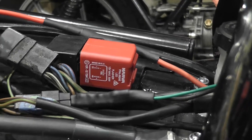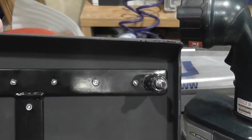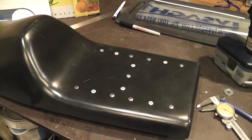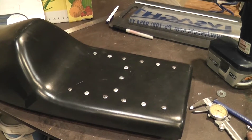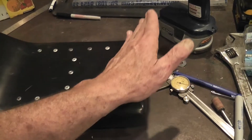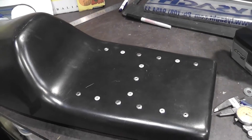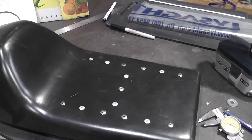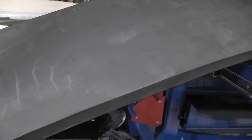That flasher unit was about $27. I've also just finally installed that mounting bracket underneath the seat with some stainless steel rivets, so that's on there good and solid. For the seat unit itself, I'm thinking — as this is going off for painting soon — I might make a fiberglass seat pan that'll be roughly that kind of shape and come up at the front. That will allow me to either upholster it or just lay on a layer of foam using this high density foam, which I've done before and it's worked quite well.